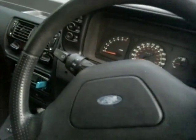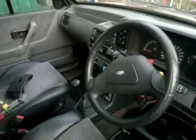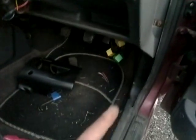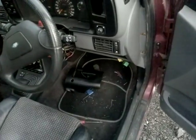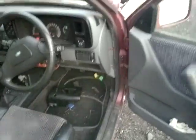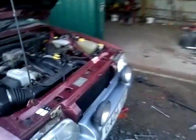My initial reaction was it's got to be a fuse or a relay, so I got towed home by the RAC. I got all the relays together — as you can see — replaced all the relays, the ones down below and the ones on top, and still nothing. Even though none of the fuses were blown, I changed all the fuses, and still nothing.